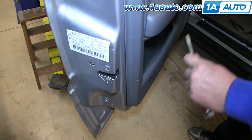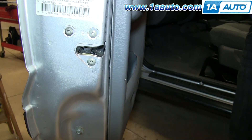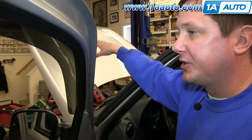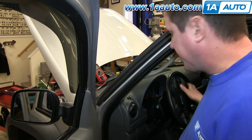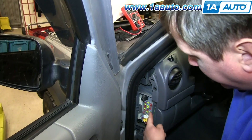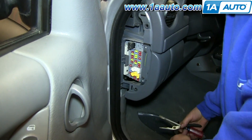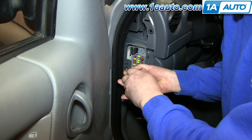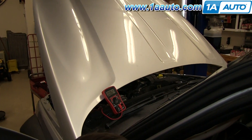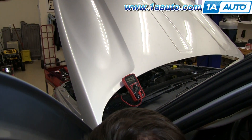I'm going to leave this door open but I don't want the control modules to think it's open, so I'm going to lock it. Make sure everything that could be off is off — if the hood has a light underneath it, shut your hood. Doors closed, keys out of the ignition. Now let's locate our fuse box and pull out each fuse until we see the multimeter go back down to its acceptable level. We pull one, put it back in, pull the next — still at high levels, so nothing on these circuits so far is pulling that draw.